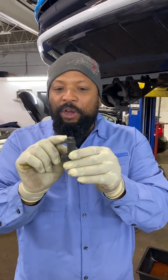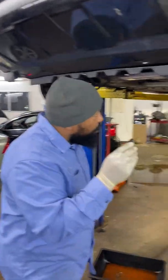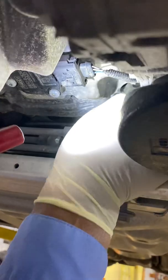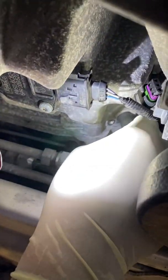When the engine is up, it's only going to fit in one spot. So what you do, you just turn the crank slowly. You remove the crank position sensor, take it out, and this goes in place of that. As you turn the engine slowly, this tool will snap into place. If you're not at top dead center, when you try to put this tool in to have it go flush, it won't go — it'll stop. You'll be trying to wiggle it and it won't go in. But as soon as you find that particular spot, it's going to slide right in. For the sake of this video, we are already at top dead center.